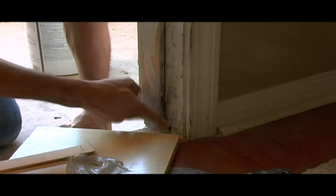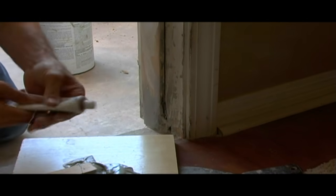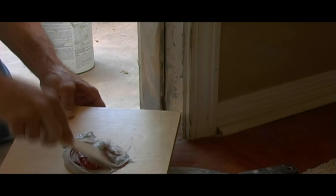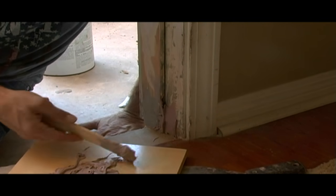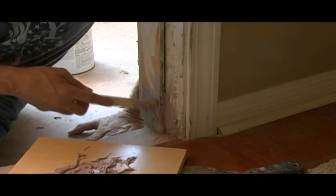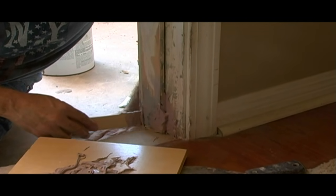This is the fiberglass — we cleaned it up and wiped it down. Now I'm going to take some Bondo and mix it up and just fill this little part right here and smooth it out. This Bondo filler is a lot easier to work with than the fiberglass — it goes on smoother. It doesn't fill holes as well, but it really smooths out and I can get a nice finish. You can shape things a little better with it because you can move it around — it doesn't have the fiberglass in it.